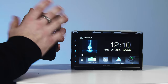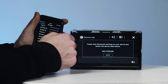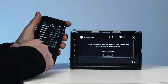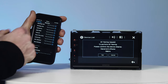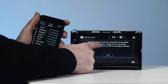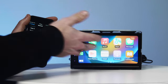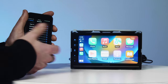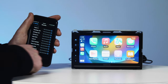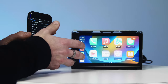Now for the iPhone — to connect for wireless CarPlay, if it doesn't come up straight away go into Menu, Device List, and hit the plus to search. Note: as it says, the GPS antenna must be connected to use wireless Apple CarPlay. Once we connect that GPS antenna, Apple CarPlay is all connected up wirelessly. You've got all the available apps — maps, phone book, music — very similar to Android Auto, though video streaming isn't available while driving.